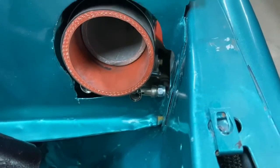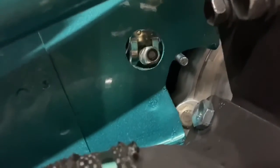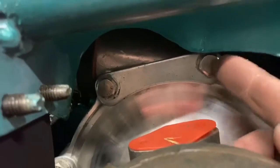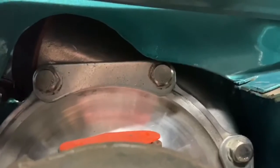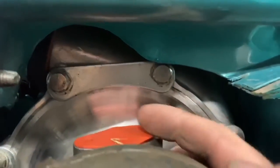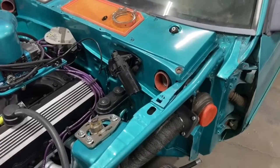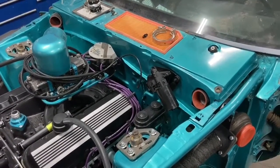This came all the way down, and the other day I had to drill this hole here and kind of cut this out so you could get to both clamps to tighten up both of them. In addition to that, I finished cutting out this area because the feed line for this turbo will come in right here. I took a body saw — an auto body saw, basically a little miniature Sawzall — and I cut that out so I can get to this feed line. I think it turned out pretty nice. I'll go ahead and get my feed lines made now.